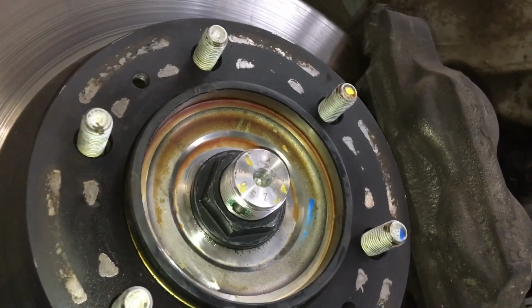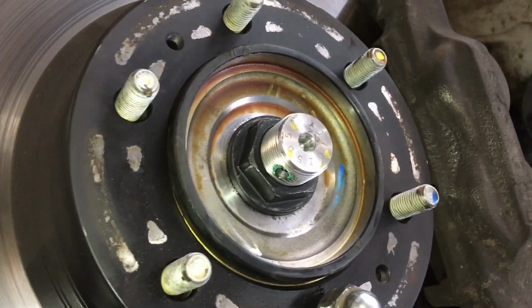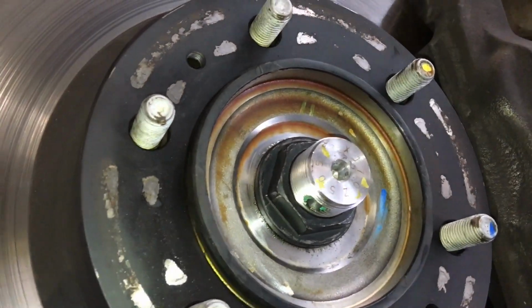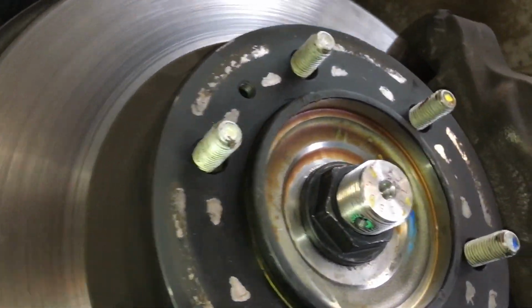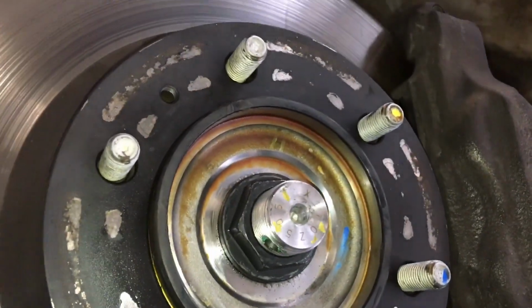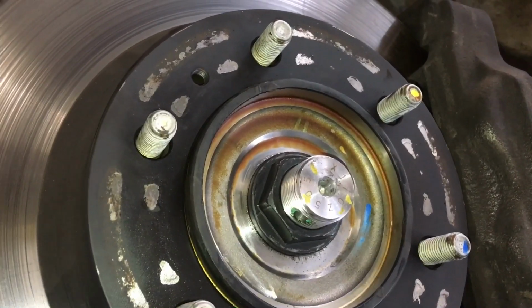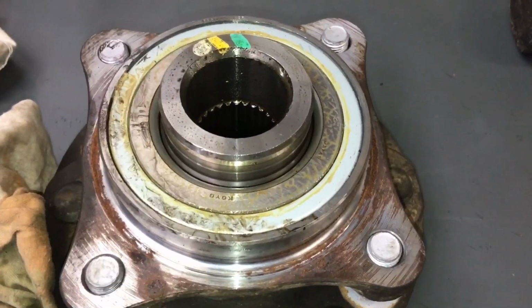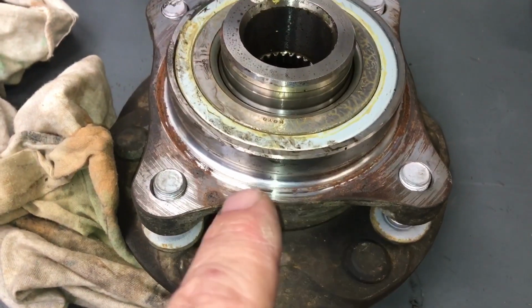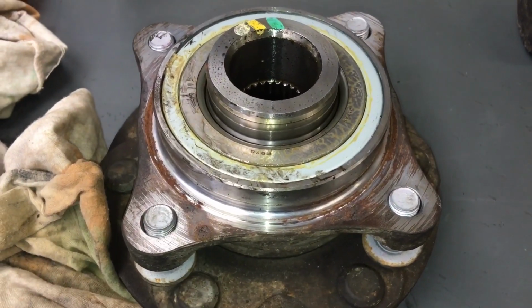But anyway, hopefully the information's been helpful so far. The rotors look pretty good still, they look in pretty good condition. They've got the black coating, so maybe someone's replaced them at some stage. Brakes are good, but yeah, just wanted to show you. Brand new, genuine is the go for drive shafts. Our little upgrade with the bearing, we use some of the better seals, not the ones listed for the Hilux, sometimes, depending what's available. Another thing we're going to consider doing, there's obviously between the ABS and the non-ABS on the Hilux, most of these components are the same. The bearings, the bolts, the hub, the seals are generally the same.